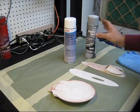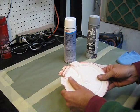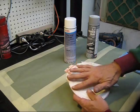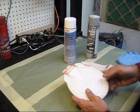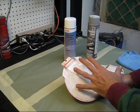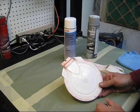What it does is you lay this down first before you even spray your primer, and you get a nice finish on here which makes your paint bond to this. So if you've got to come back and do tape work or anything like that and you're going to be painting multiple colors, it allows you to pull your tape off with confidence knowing that your base coat down here is going to stay. You're not going to be pulling up chunks of paint every time you pull a little tape off of it.